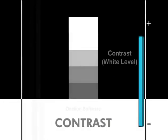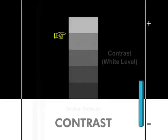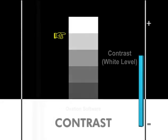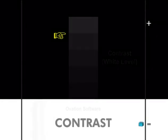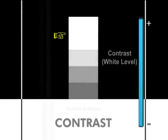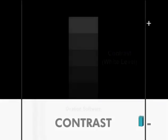We're ready to tune up our TV. For best results, it's important to follow the steps in order. First is setting the contrast, technically called white level. If contrast is set too high, you'll shorten the life of your TV and exaggerate video noise. This is a demonstration version of the test pattern used for setting contrast — don't make any adjustments yet, just watch the tutorial. Keep an eye on the white box on top of the stack in the upper portion of the screen as we raise and lower the contrast. You'll notice when contrast is high, the edges of the white and lightest gray boxes become less sharp and start to bleed into the surrounding black area — this is called blooming. The best setting is found by adjusting the contrast to the point just before the blooming begins.